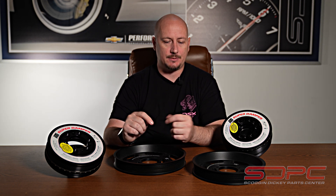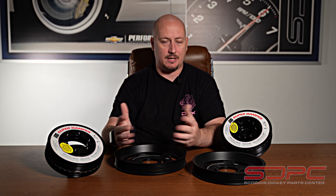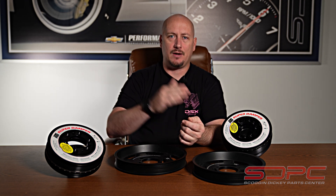The rotor pack can actually have issues all the way up to catastrophic failure. You've probably seen pictures all over the place, whether it be in CTSV groups, Z06 groups, or over in the Hellcat groups — we've seen them all running blowers at excessive amounts, especially if you're trying to chase a stock blower record. If you're just running as a daily driver or a relatively stock car that you maybe take to the track, you probably don't want to be running at the extremes. On top of excessive blower wear and putting your blower into a dangerous level of RPM, you're also pumping out ridiculous amounts of heat to where you're actually hitting very severe diminishing returns — and sometimes even worse performance than what you'd have at a different pulley combination.